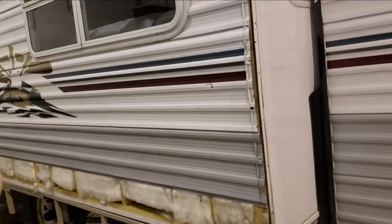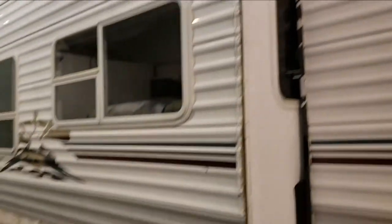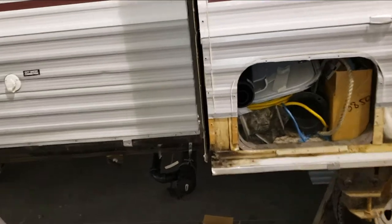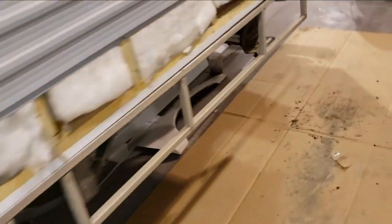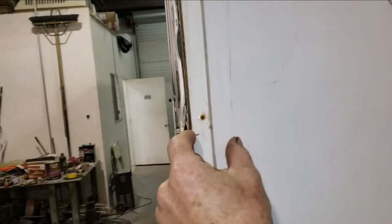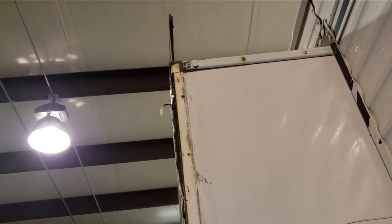I'm not going to be rebuilding this slide-out to some outrageous level. I will do my best to cap off the roof so it's not leaking anymore, but this really was just an insurance job for the damage down here. I don't want anything to damage the work I just did. We're going to be upgrading the slide-out seals to a new modular style so they're easier to replace in the future — and it should be better than factory since it was obviously leaking. Because my fascia is going to be a little bit wider, it'll cover up there and we'll be able to seal it up a little bit better.